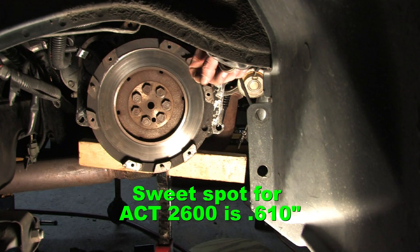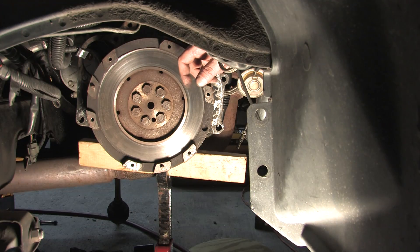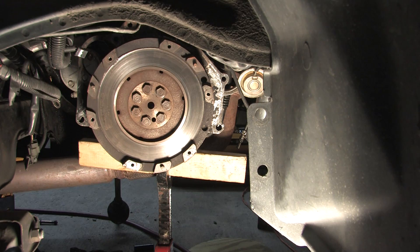Step height is the distance between the flat surface and the friction surface — it's a depth measurement. The larger the number, the greater the gap the clutch has to operate. Too large and it slips because it's not able to clamp the disc down; too tight and it won't disengage fully. You only get a few thousandths of an inch of range to play with, so whoever surfaces it must be precise. I paid a reputable shop to cut mine because I don't have the tool.